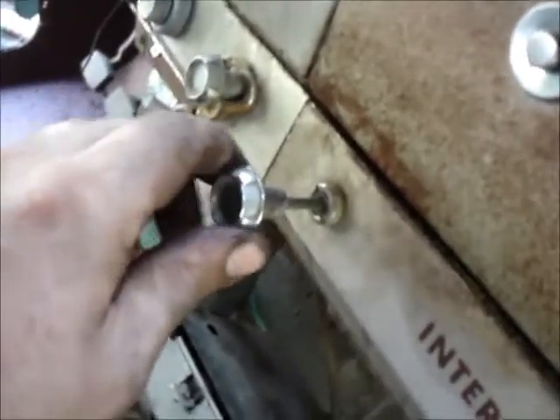If you ever get one and notice it's not heating up, you have to pull this knob out, then turn on your heater. Because if you look, there's a big flapper inside of there and that shuts off your air. I guess it's for shutting off the outside air. If you've got one of these and you're not getting heat, try oiling up that knob and the cable that goes out there and see if you can free that up. It might help you.